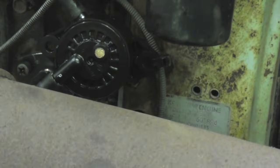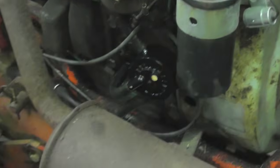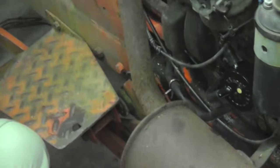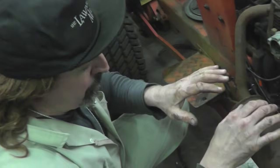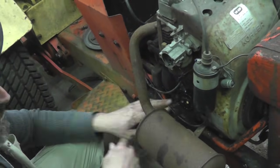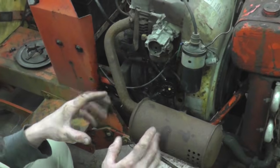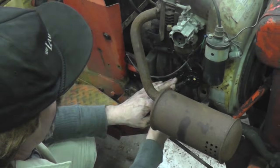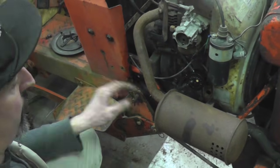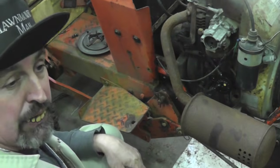You know, when the air cleaner and everything go back on, it's going to cover up some of that. Now, all these Kohler engines are different. If you got a spot to mount that fuel pump without kinking these lines, then you can mount it with bolts somewhere, or make a plate, or fancy it and gussy it all up, whatever you want. But this one, I just zip tied it out to hold it good. It ain't gonna hurt nothing right there. We're gonna put some gas in it, and then we're gonna start it, show you how it works.